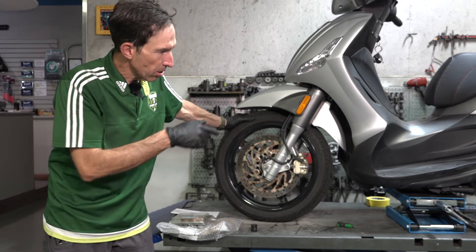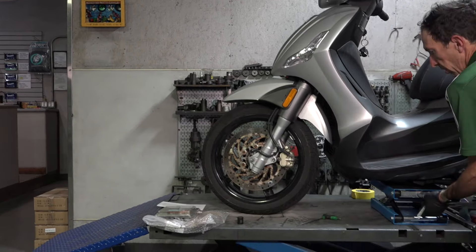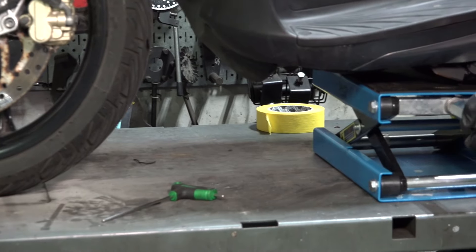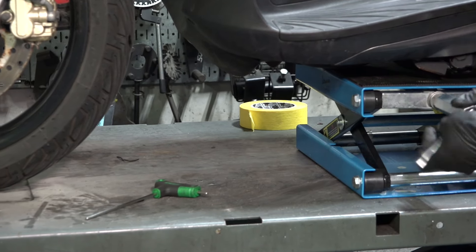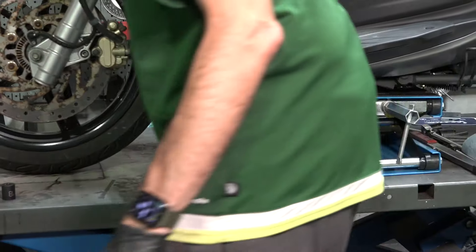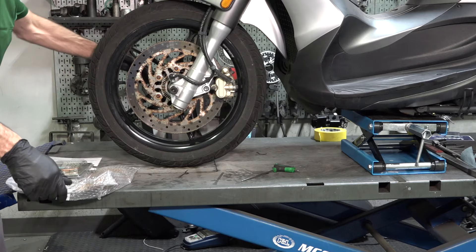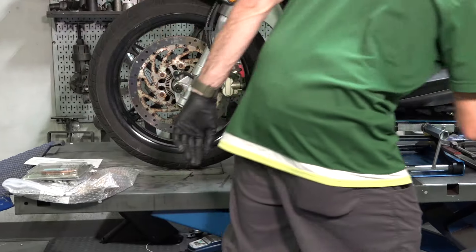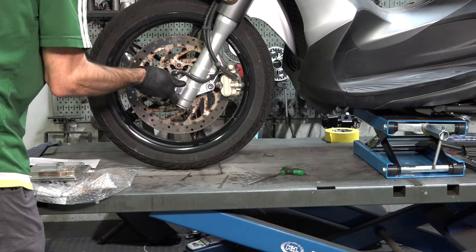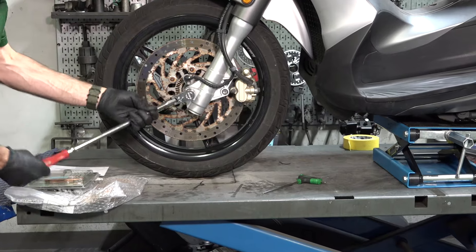I have the rear of the scooter clamped on the tire and I have one of the scissor jacks — we have these available at ScooterWest.com. In the center there's a metal crossbar right there that protects the fuel tank, and that's actually the jack point. First of all, you want to have an 18 millimeter socket. Before you even loosen the axle on the right side, you need to take the axle nut off. This usually has quite a bit of friction.